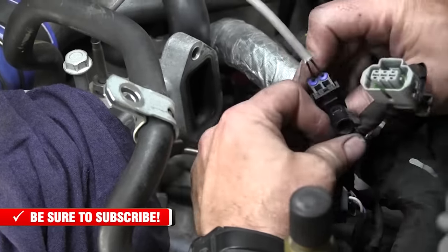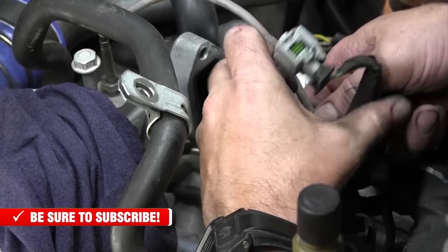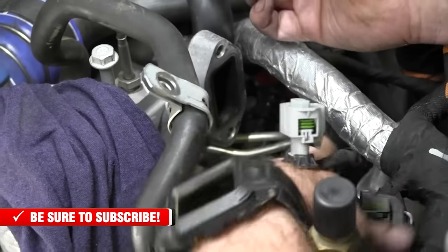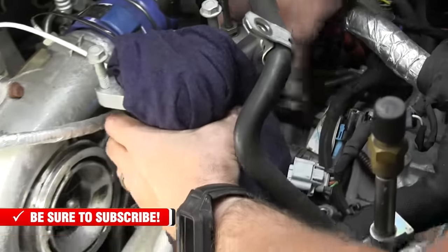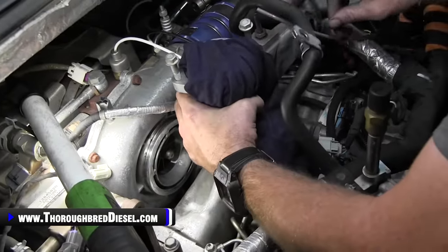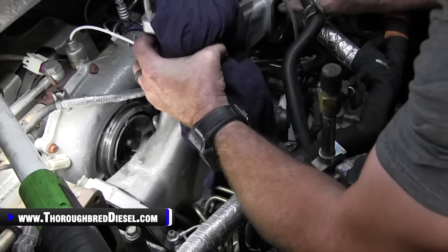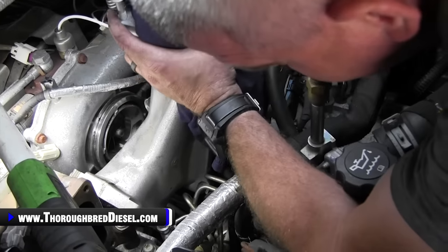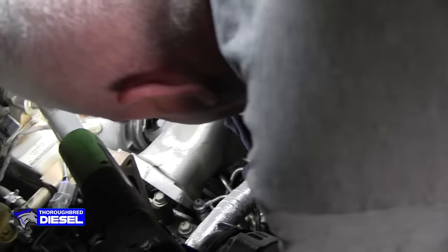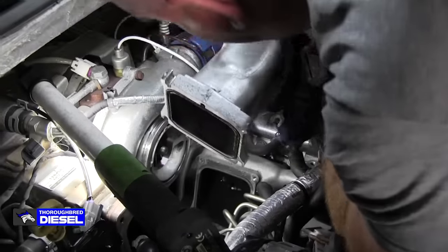And that one would release, but that's all right. All right, just pull straight out of the harness like that. And the crossover tube will lift straight up, and just watch your coolant line here, which I have not removed yet, but it should clear it anyway. Up and out.